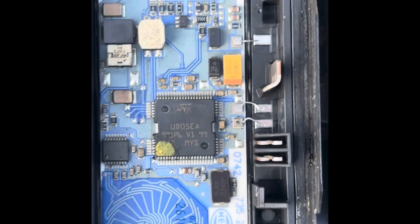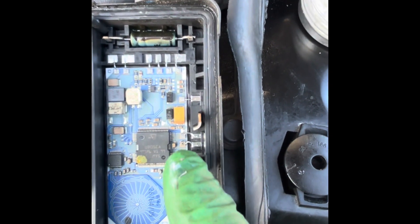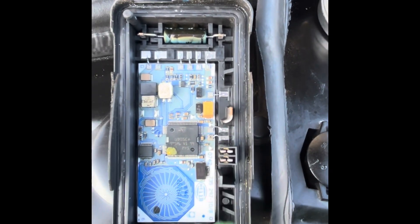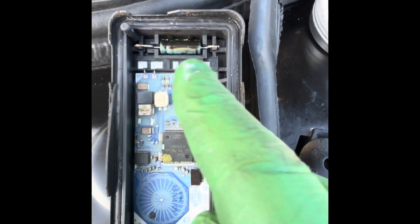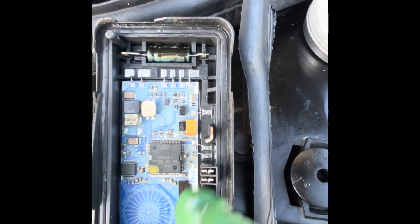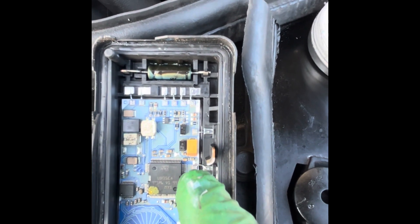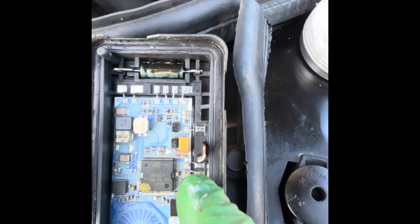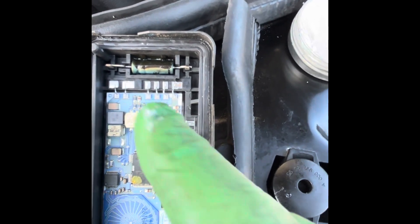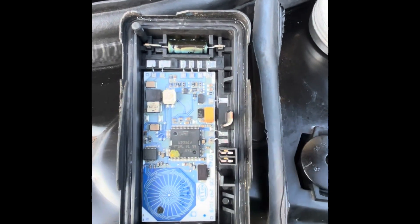Now in their wisdom, my original intention was just to re-solder these — re-solder them all, easy yeah? No. They're all bloody aluminium coated, which means to do two simple solder joints, I'd have to grind each one of these tiny connectors down to the copper base and then do it. And if I'm going to do those two, I might as well do those two as well. It's a pig of a job, it's a pain in the arse.